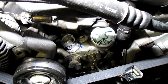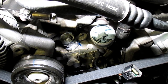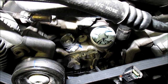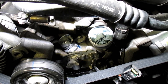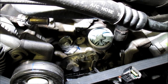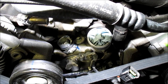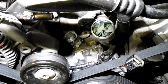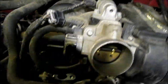That all being said, there's always a possibility this thing is off a hair. I tried to get it as close as I could to the position of the previous one — it's certainly not grossly wrong. There's always a chance it could be off a degree or something. Even with the top dead center method, if your TDC is off a hair you're not doing any better. The timing light method is probably more accurate for establishing a known spot.